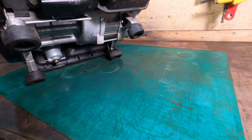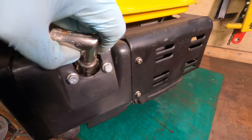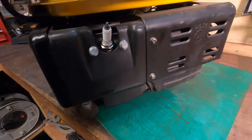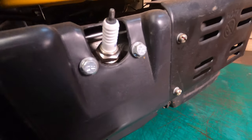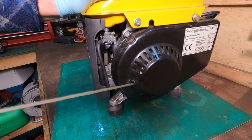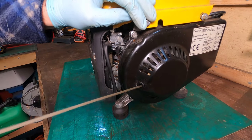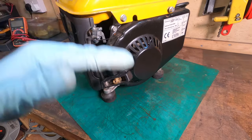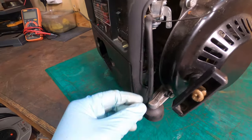The feet look in pretty good condition, which is a good sign it hasn't had much use. It's got a spark plug which looks new - looks cheap, can't really see the brand but it's not a main brand. It was a bit tough on the first pull but the piston was just catching on a lip maybe. The fuel line has perished - in fact it's not even attached to the carb.